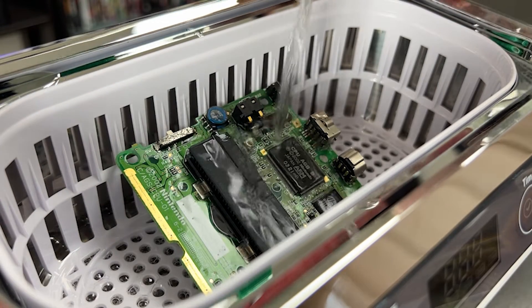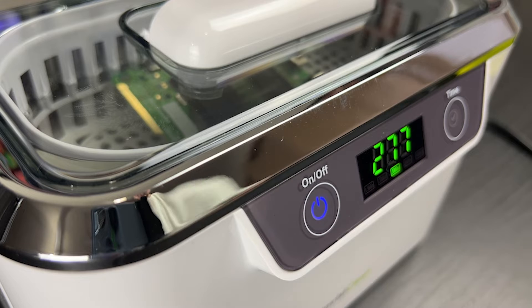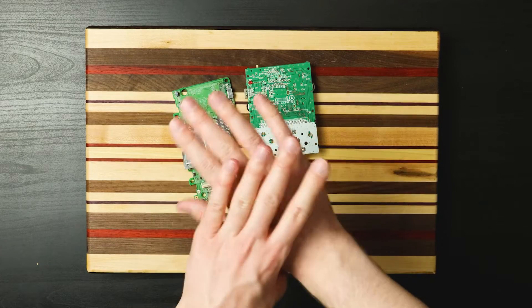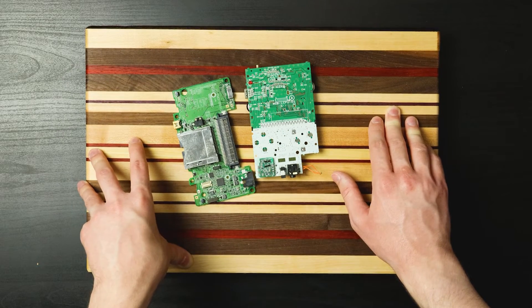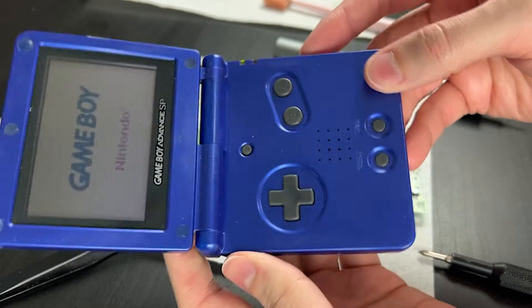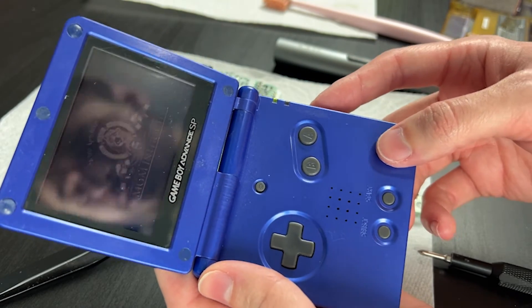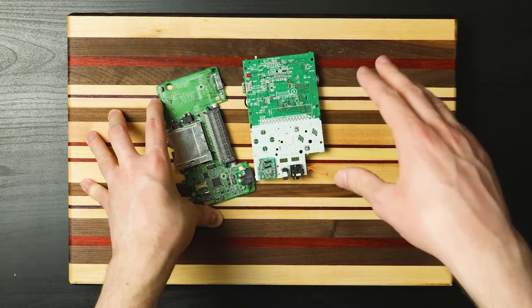After I started messing around with ultrasonic cleaning, I grabbed that SP because I'd kept it — still determined to fix it. I threw it in. The cart slot was so dirty. Yeah, I could have swapped that cart slot out, probably should have, but at that point I wasn't confident with hot air like I am now. I threw that SP in the ultrasonic cleaner and it works now — it was able to clean whatever gunk was on those pins. I didn't have to risk ruining the cart slot or the board. If you rip any of those pads, it's probably going to rip multiple pads — desoldering is just hard, especially when the connector sits on top of the board.